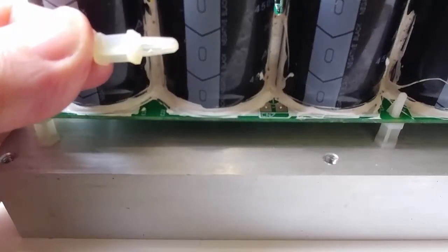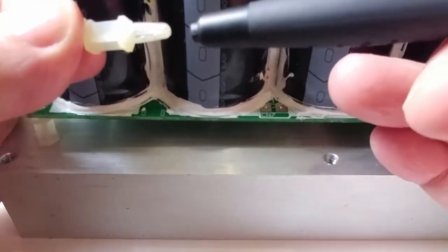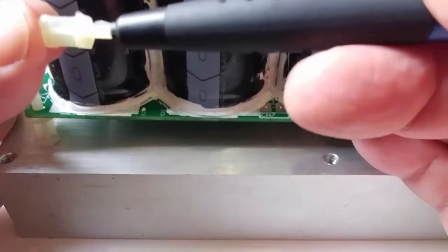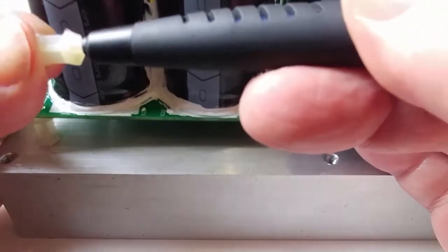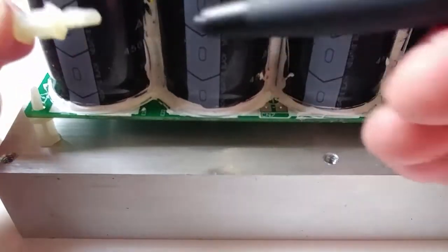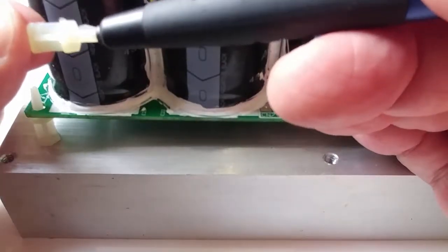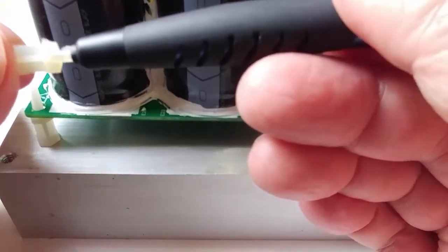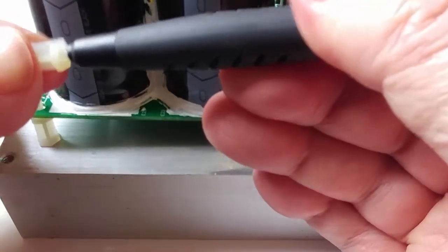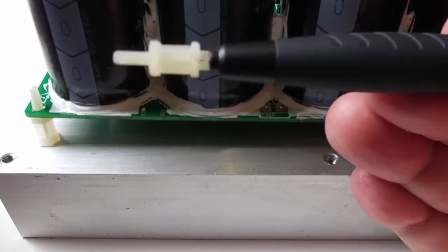These nylon bushings differ by about half a millimeter on different boards, so the board I have is different than the one in production. We can see that this is actually a proper fit, and that's how I sized this particular pen for doing the compression — it works just fine. But the barbs on this board are a slightly smaller diameter and they're passing by. It entirely comes down to sizing the pen correctly to get that fit, and when it is a nice, correct fit, it will look like this.